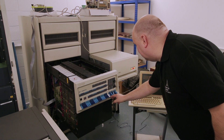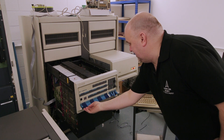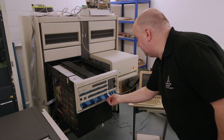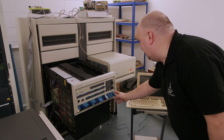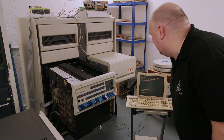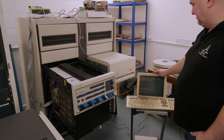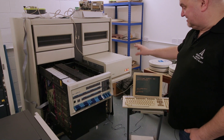I'm halting the computer and loading the address, which is 1 7 7 7 3 0 0 6. Each set of three is a code from zero to seven — the PDP works in octal. I'm going to load the address and start. Now the computer should start to boot. We'll see the light flickering on the front of the drive and we'll get a banner for the operating system installed on that disc.